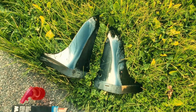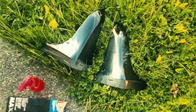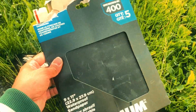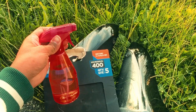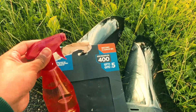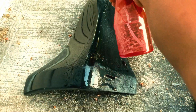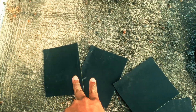What I'm gonna do today is try to paint match it to my car. It's obviously not gonna be perfect, but I have to prepare it first. I kind of washed it already but I might give it a quick wash again. Basically all you need to do first is get 400 grit sandpaper — we're gonna wet sand it. I'll do two layers of wet sanding, let it dry between each, and then after that we'll go for the adhesion promoter. I cut the 400 grit paper into four pieces, so I'll be using two of them on each mudguard.